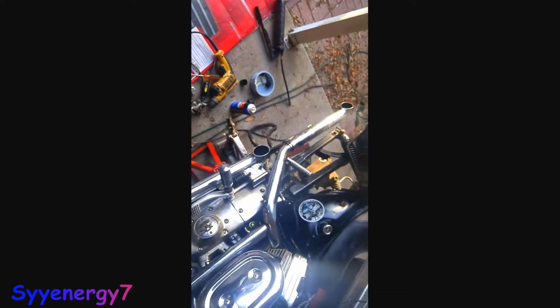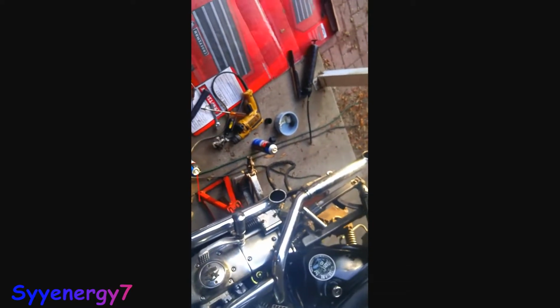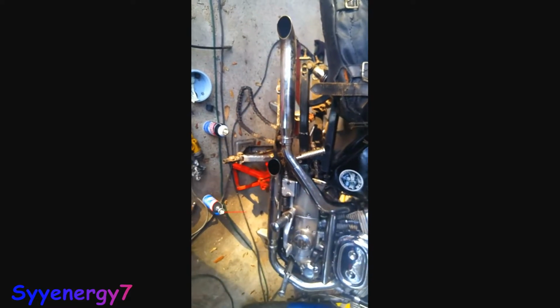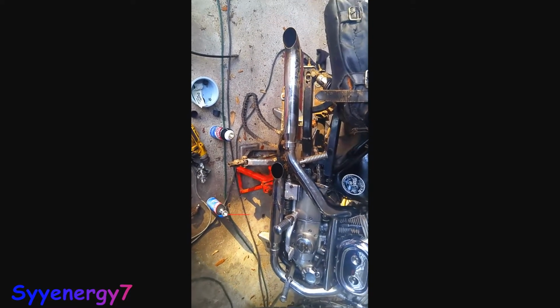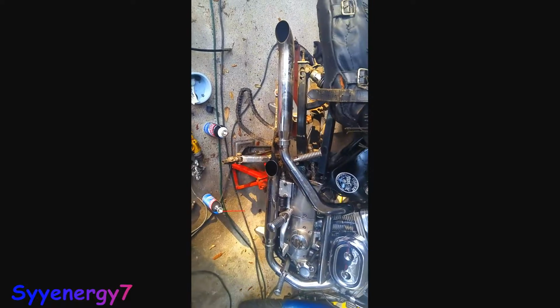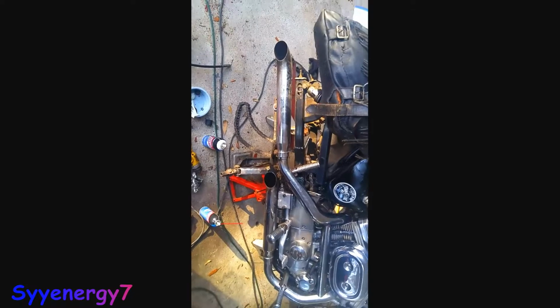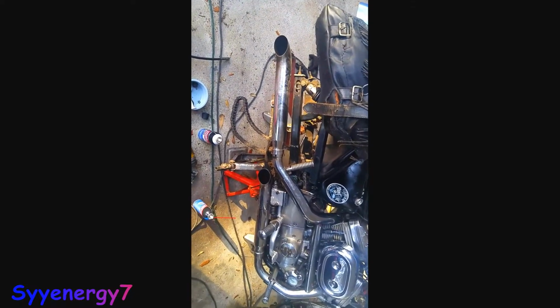It's the moisture. It's not even so much the dirt, it's the moisture. You're not going to get heavy dirt in there, you're going to get a little dust. But if it's loaded down with grease, there's only a tiny amount, because there's not much movement in these parts. It's the moisture that rusts out the bearings. Look where it is. The wheel's kicking up all the crap right in that area, so the whole bottom of the bike is getting wet. That makes it a hell of a lot easier to do this,